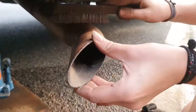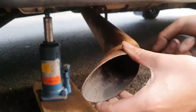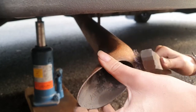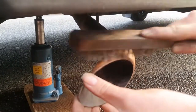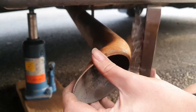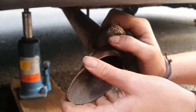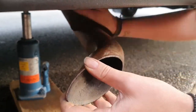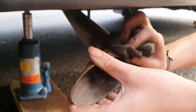We're going to show you how it's done. Your first step is going to be to use a metal wire brush to get all the rust or dirt off of the exhaust pipe. We had a lot of dirt stuck on ours that was really baked on, so we needed to take a really big wire brush to get most of it off. That also left some pretty deep grooves, which meant we needed higher grit sandpaper to get those grooves out in the end. Once you're done with the wire brush, wipe it off with a microfiber cloth.